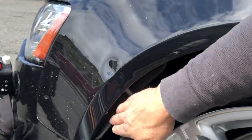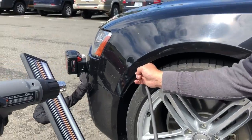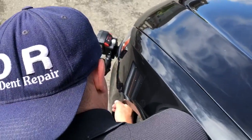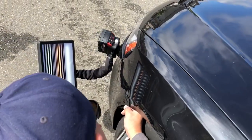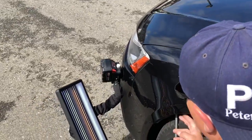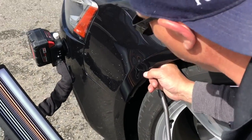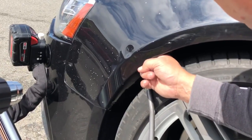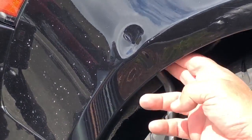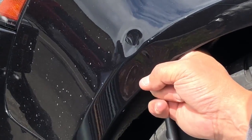I've got this pulled back and I'm just gonna start babying this dent out. I'm just trying to find my right push, because we don't want to just go in the center of that and make a large push. I'm basically trying to run this edge first, and now that I can kind of see where my tool is, let me grab a different angle.